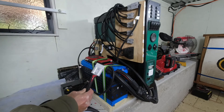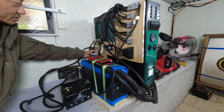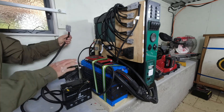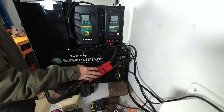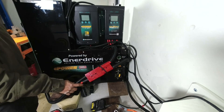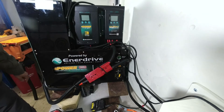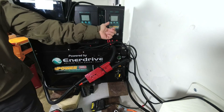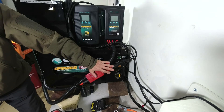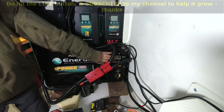I have a 150 amp Anderson connector on the cable connected to this lead acid battery. I'll plug this into the socket labeled 'car battery in'. This means the Enerdrive system will then be receiving 12 volt power from this battery. There's also a battery reset button on the side of the dual BMS cable that connects the Enerdrive Adventurer to my 240Ah battery. This button fundamentally short circuits the car start battery — connected to my small 12 volt sealed lead acid battery — to the big 240Ah battery, which in theory should wake up the Daly battery management system. I'll push this button and see if that works.